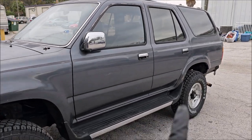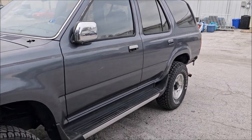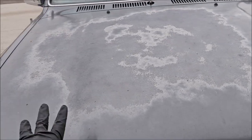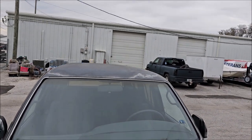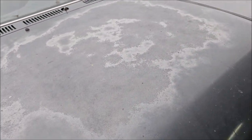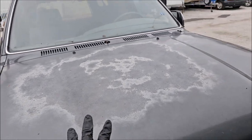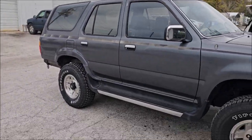He's looking to make this thing look amazing and sell it, so we're doing a base coat/clear coat. The paint code is Toyota 179 Dark Gray Metallic. I'm going to tape it up, scuff it up, and then spray it. I've got to get rid of a couple of little dings, do some body work, and I've got to strip, prime, base, and clear the hood and the whole roof — as you can see, it looks like crap. I'm going to start with some 320-grit, see where that takes me, get it all smoothed out.